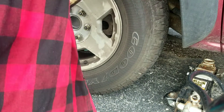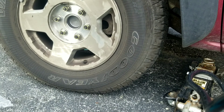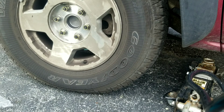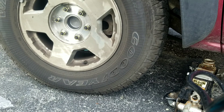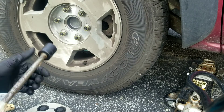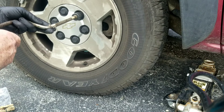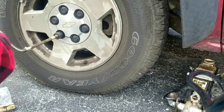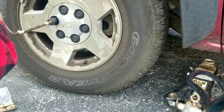And that's it. I didn't use a torque wrench. If you want to use one, look up the specs. But I've done this for a lot of years and I just go by feel — those things don't have to be over-tightened like Walmart does it. Now put the hub cap back on. Don't over-tighten these — use the same side-to-side process. Just snug them down; they're plastic and they will strip.